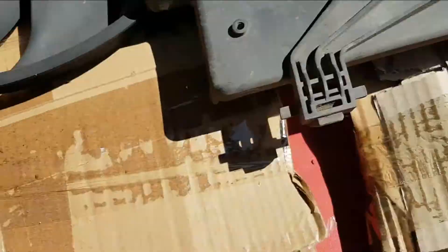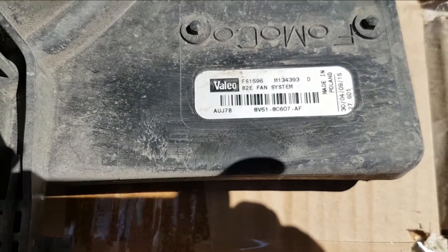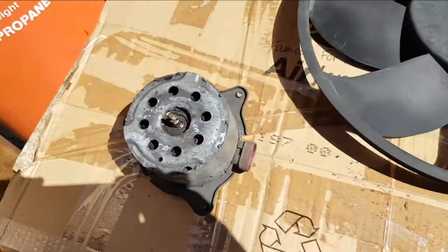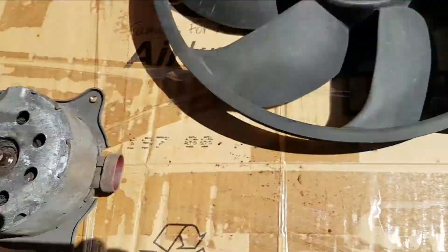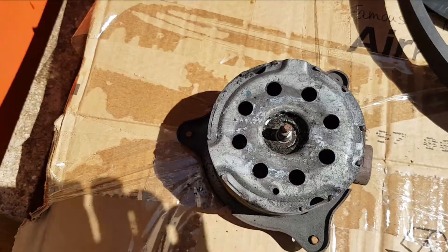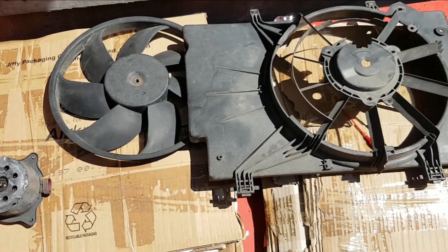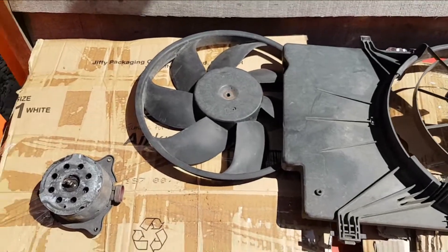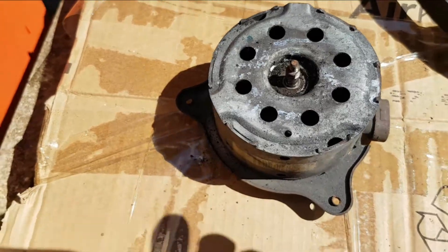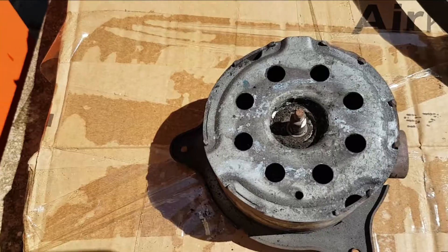You can see it was made proudly by somebody in Poland - the car's on 100,000 miles. You can't just buy this knackered bit; this bit comes out easy, it's just held in by three screws and a left-hand threaded nut that holds the fan on. No, you can't just buy the motor - you have to buy the whole lot for 100 quid. Typical. This motor is kind of sealed but openable, because these tangs here are just holding this plating, and I'm going to stick it in the vise - I think it's a brush motor.